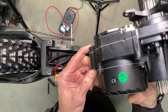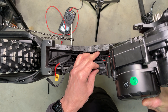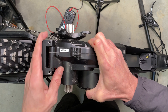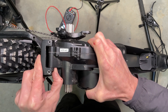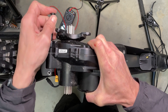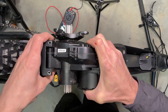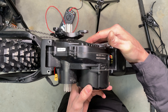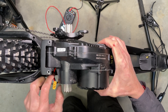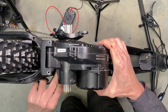You put this end about right here — not directly where it should mount, but just a little bit off, so you have just enough space here to put the first pin in. Now you can work on the motor. Make sure with your fingers that the power wire and the two main connectors are sticking out and are not getting squished between the frame.